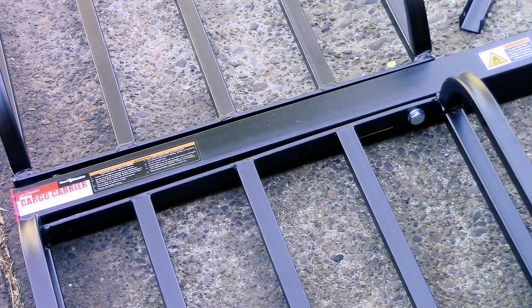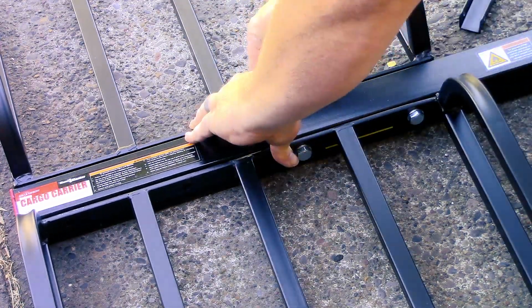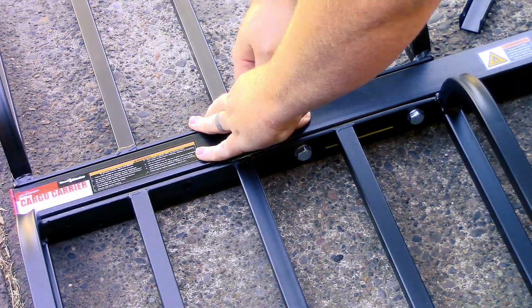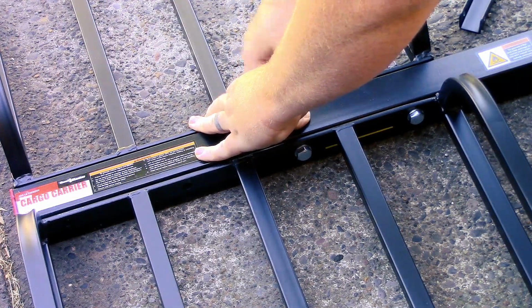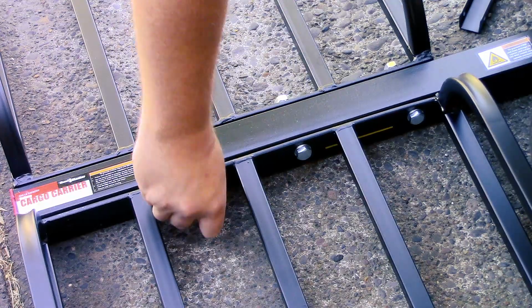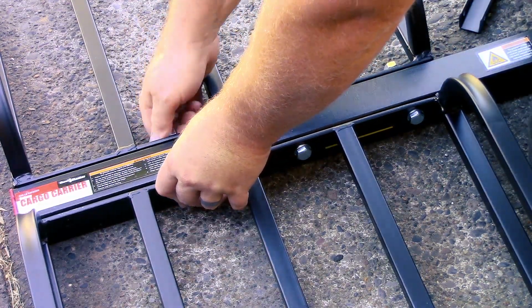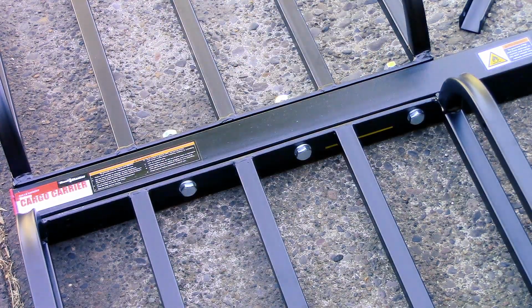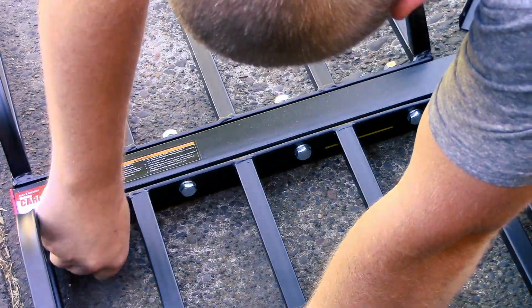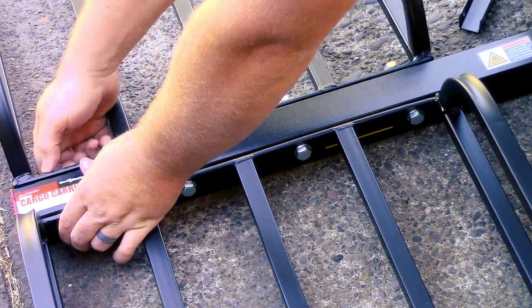You want to grab the first bolt, place the large flat washer on first, and then slide it through the first platform section, the matching hole on the hitch, then through the other matching hole on the other platform section. Once it is through all the holes, place a lock washer onto the bolt, followed by one of the large locking nuts. You only want to hand tighten the nut. It will be considerably easier to finish assembling the project with everything loose, and then come back at the end and tighten everything down.